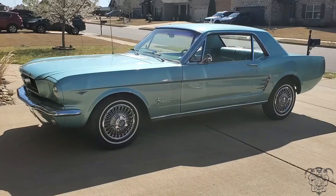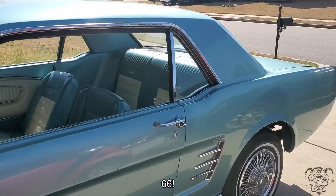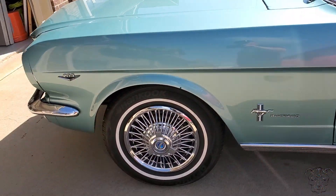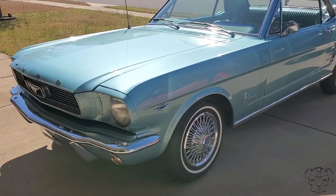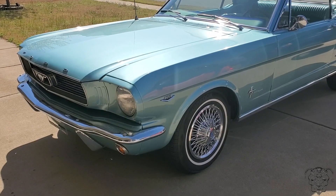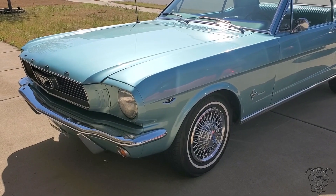Hey folks, welcome back. It's been a minute since I've been on here, just been really busy. Still waiting on parts and all kinds of stuff. But today I got the pleasure of helping a friend out — here it is, a '67 Mustang 289 variant, looks like an automatic. The problem is it's running rich. I mean, this thing is running rich as Bill Gates. Popped the hood and one of the plug wires was off, put it back on but didn't solve it. The choke is very slow to open up — like the heater tube is plugged or the vacuum source or something like that.